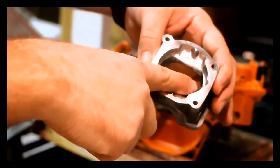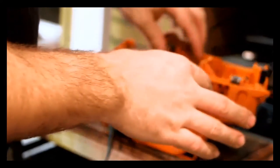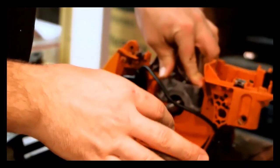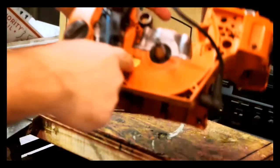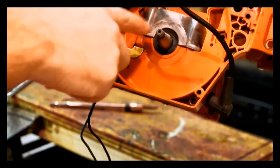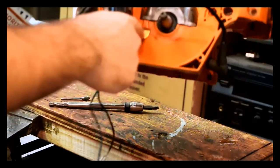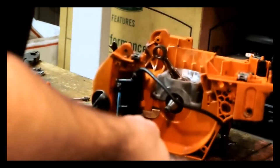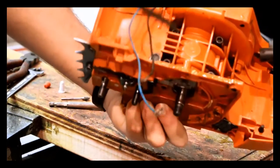The part that we notched out here goes towards the intake side. Now this is often where you do something stupid and forget something. Here's what you can forget if you're not paying attention: this brass piece right here. If you have the whole saw dismantled and you're putting it back together starting with the crank, seals, and bearing cap — don't forget this brass piece, because that's the ground. At least I think that's the ground. Now we're going to seal up the bearing cap from the underside with the bearing cap bolts — these need some blue Loctite as well. Four bolts on the bottom.